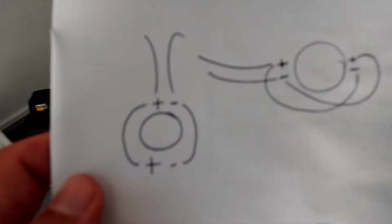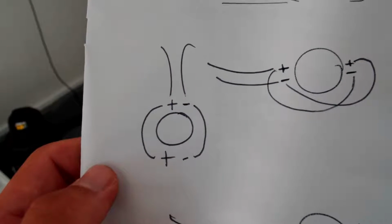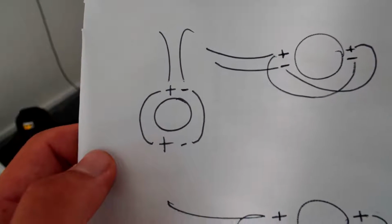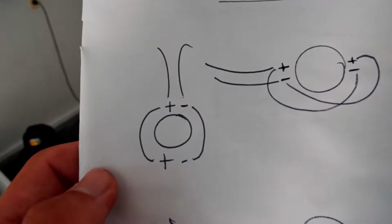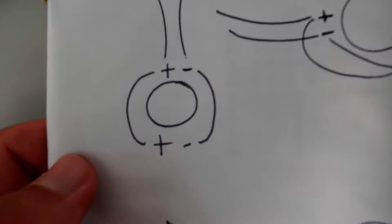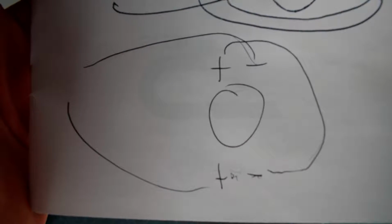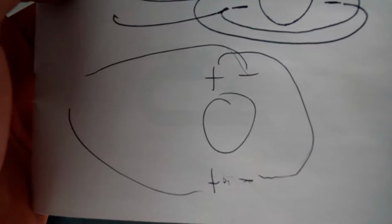I'll show you this little diagram I was looking at. So this diagram right here that's in the center, this one is a parallel wiring diagram. So there's 2 paths for the electricity to flow, and it has to flow through both. So that's parallel. That's going to give you a 1 ohm load with dual 2 ohm voice coils, and this down here is series. You have 1 wire coming into the positive and a wire on that side going from negative to the positive on the other side, and then your other amp wire goes to the negative on the other side of the voice coil. So that's series. That'll give you a 4 ohm load.